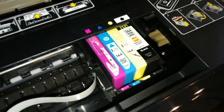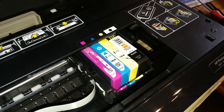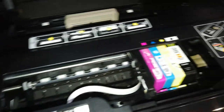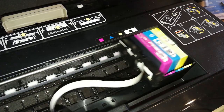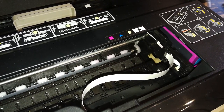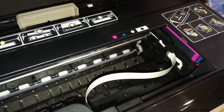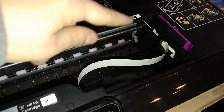From here you should be able to see the defect I'm talking about. Now we'll close the cover. By the way, to bypass the switch you just need to take a piece of cardboard or anything and put it in this slot right here, and you've bypassed the switch. Have a look down there — that is the cleaning pad. You can see it's jamming to the rear and it's grinding when it reaches the rear.